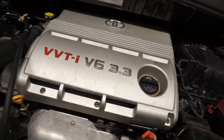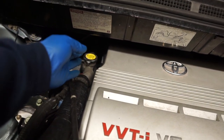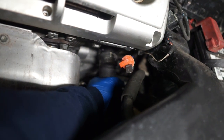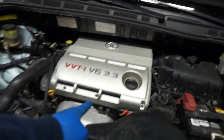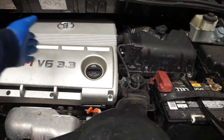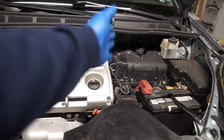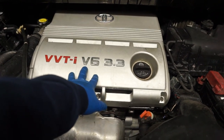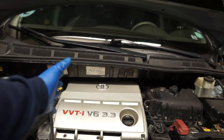On this Sienna, the way I figured out it was the thermostat was pretty simple. I had the truck running, there were no leaks. The radiator cap — or coolant fill cap — is right by the cowl, so I couldn't put a pressure tester on there. When I had the truck running, this hose right here was super warm, but this hose right here was cold to the touch. On this van, the thermostat sits right in there — that is a dead indication that when coolant is circulating through the engine on its way back to the radiator, if that coolant hose is cold, that means the thermostat is stuck closed and it's not letting the hot coolant get back to the radiator to cool and recirculate through the engine. Stuck thermostat — we're gonna be replacing it. We're also removing the intake manifold so we can access the back three plugs. Three of them live right here under this cover and are pretty easy to access. We're gonna start off by removing the wiper cowl. Let's get to work.